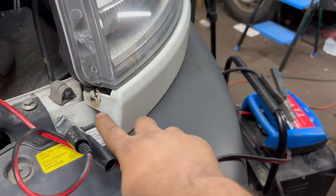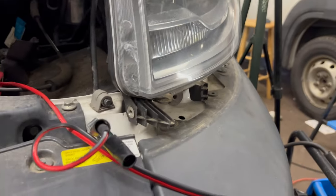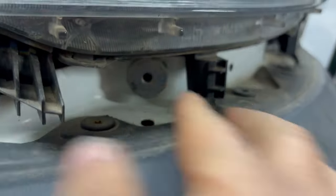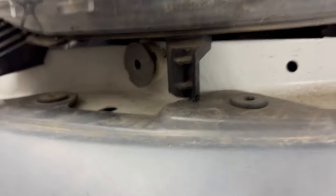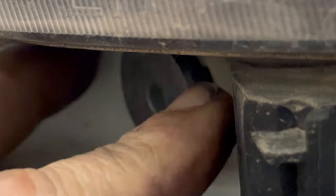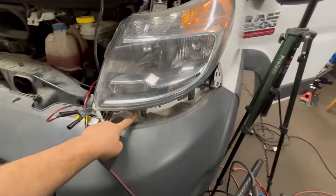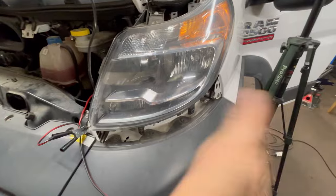The horizontal adjustment is equally simple. I've removed the 10 millimeter screw here and this panel just comes out. With the panel off, here's what's below it. This particular headlight bucket is broken, but it's a good illustration of how this actually works. This is a two-stage fastener — see the knurled section in there? You can turn the two independently. As this threads in, it's going to tip the whole headlight this way; as it threads out, it's going to tip the headlight the other way. So that's your horizontal adjustment.